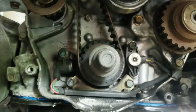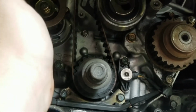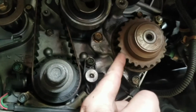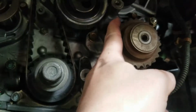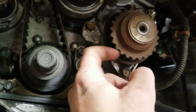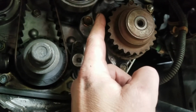So now we got to do the balancing rods. Those have to be in a certain time. If you watch this, when I turn it, it'll turn back itself. It's because it's got a counterweight inside there. And then this also has a gear. So every, I believe it's 3 times, for every 3 times this turns, the counterbalance shaft only turns once.